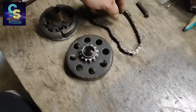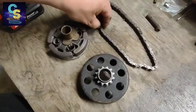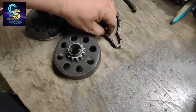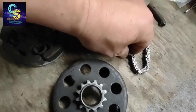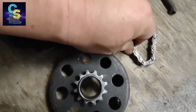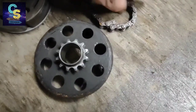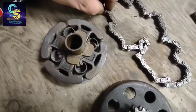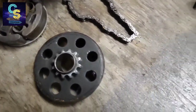I inspect our number 30, I think, roller chain. I'm going to go through and make sure all of these move freely. If they don't, like this one's a little bit tough. That one's a little tougher. I'll get some WD-40 or PB Blaster in there, free that up. Make sure that chain's going to move nice. I think it's either that it sat on the concrete, or it got dripped on, or it got hot, or somebody forgot to oil it, because that's not that bad.